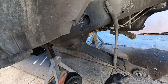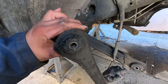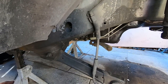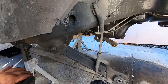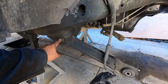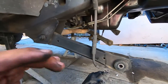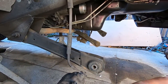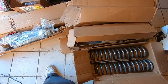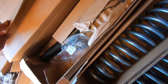The control arm is out and you can see the upper control arm bushing is pretty much shot as well. When you lift a Jeep and don't replace the bushings it's going to have death wobble. It would be good to replace the bushings if we were going with a smaller lift, but since we're going with the bigger lift with the long arm kit all this is not needed. Also we have to remove this nut and bolt — it comes off as well. In the beginning of the video we forgot to show the parts: these are the four and a half inch coils and this is the long arm stuff.